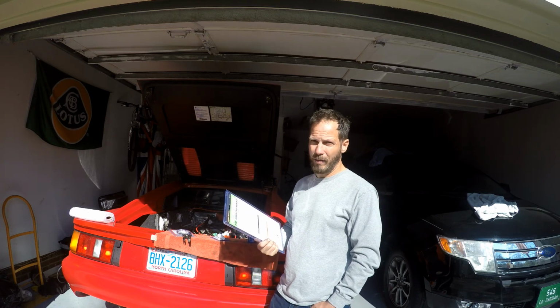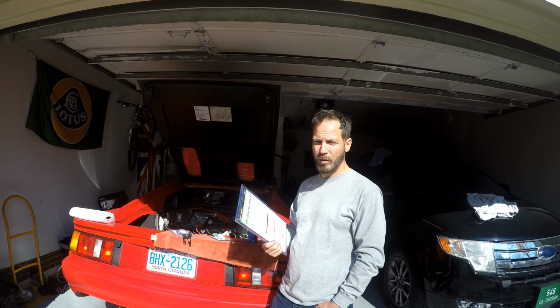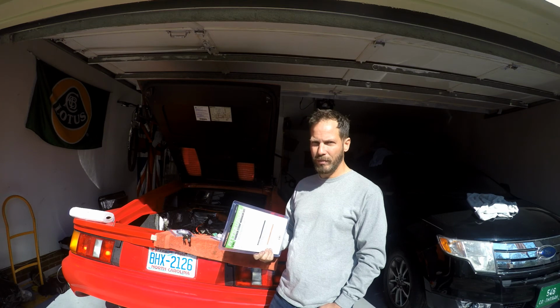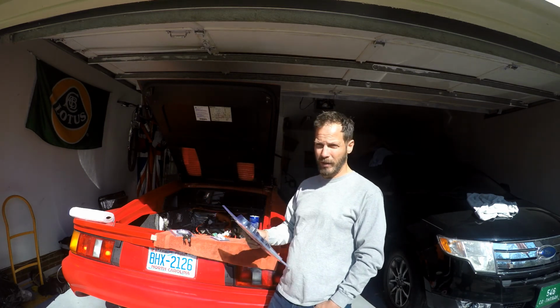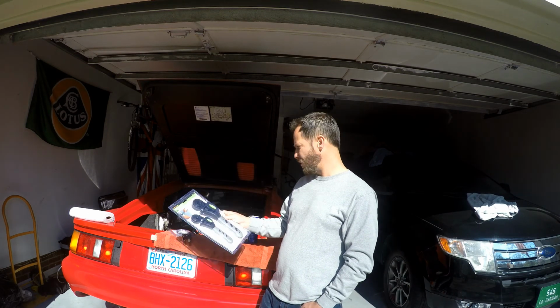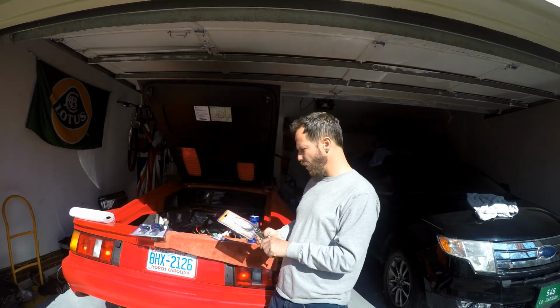Normally you've got the cam belt on there and you can kind of prevent it from spinning because of that, but the timing belt's already been loosened, but I can't get it off or put the new one on until I take the crank pulley off. So initially I was going to use these, but then I saw this that would probably work better.